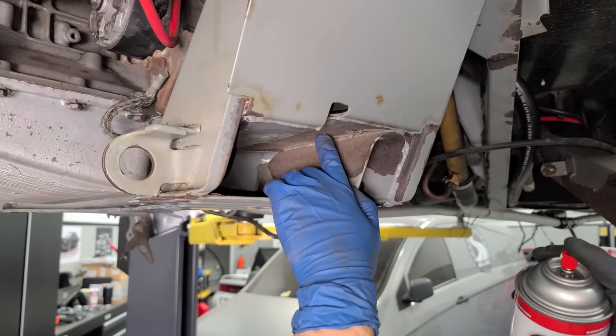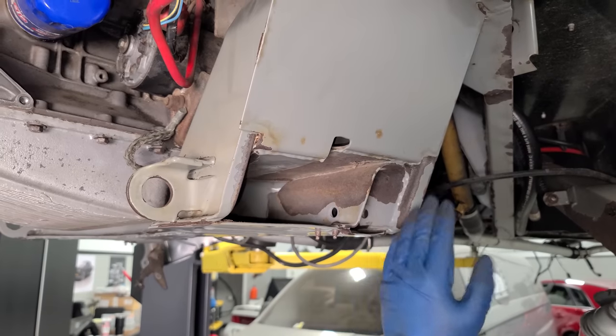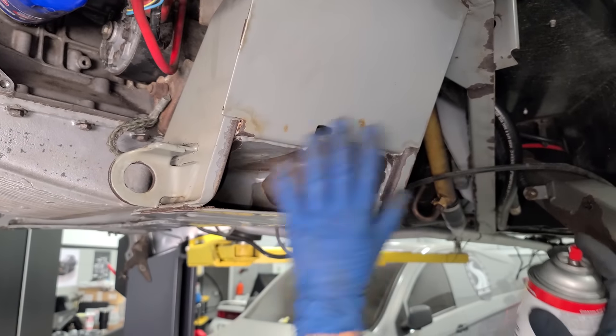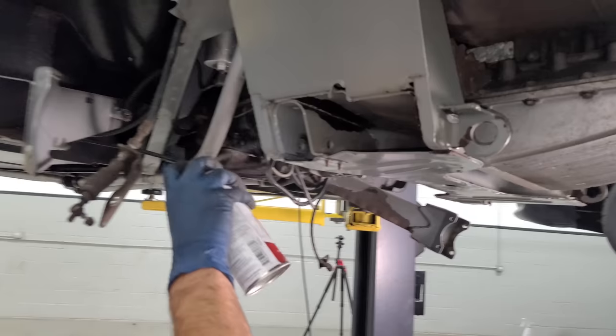This is the plate we're gonna replace, and we can get to it by removing this bottom one, but OJ said it'd be better if we can get to the top as well, so we can just take all of this out. We'd actually remove these perches, blast them down to bare metal, and reinstall them, and just literally make this like a brand new frame. Just gonna take some work. All right, I'll go around and do the rest.